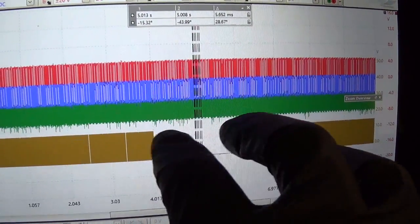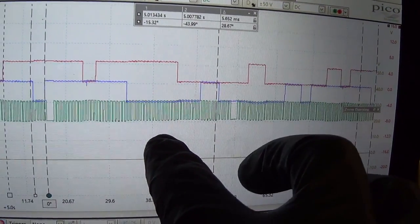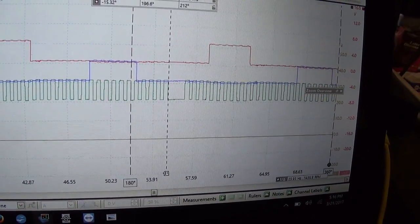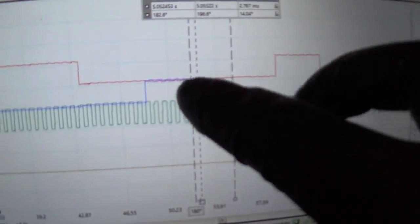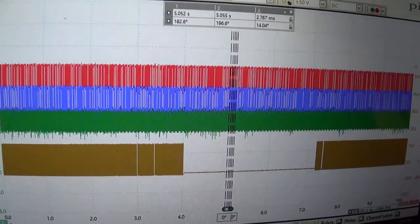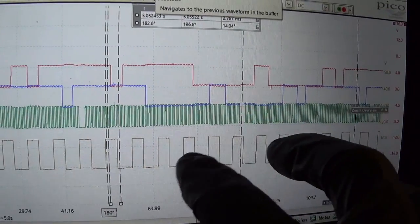So actually, we can do this. We know this is 0. So if our 0 is from here, we're using the crankshaft sync notch as our reference. So when we're commanded 0, it's 14 degrees crank. Okay, and when I went all the way up to 25 on the scanner, that should have been somewhere in this frame. Zoom in here. So like right here.